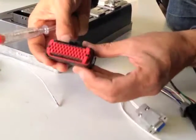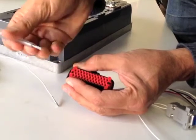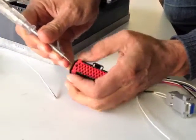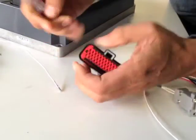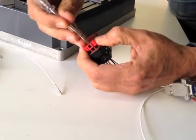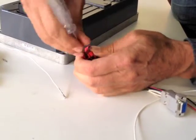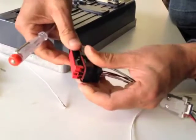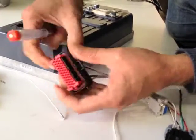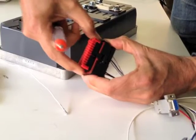To get the plug open, there are two ends to it. I'll do the front end first. You just put a small thin-bladed screwdriver in the front there and pull that black tab back. In theory this should just snap open on one side — you're lifting the red part out. It's always tricky when you've got an audience. So I've started that end. Now you can see it's starting to slide out. It comes out so far and then it stops — it's not going to come out any more than that.